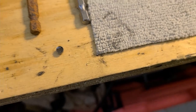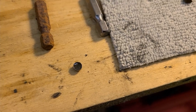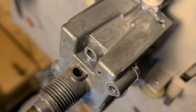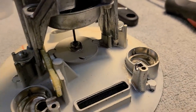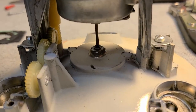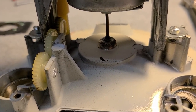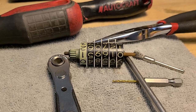Mixed the JB Quick 50/50, settled it inside using an orange pick tool - it self-leveled and looks almost professional. Poked the felt wick back in with about three drops of white mineral oil on it so it stays lubricated. Testing rotation confirms the clicking and worm gear tooth jumping has stopped - all gears have white mineral oil on them and it runs butter smooth.